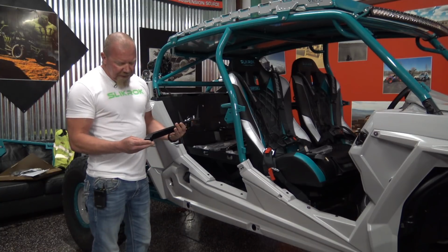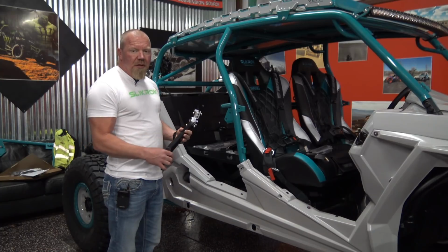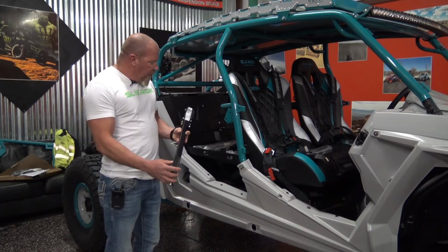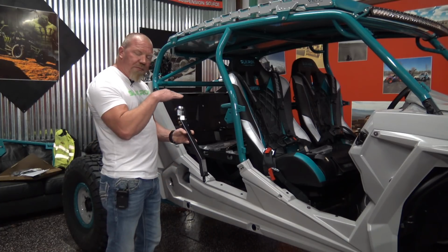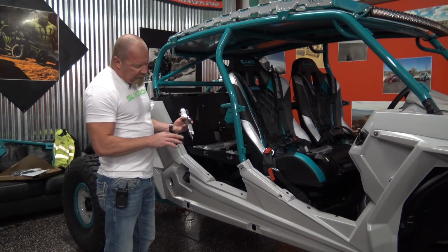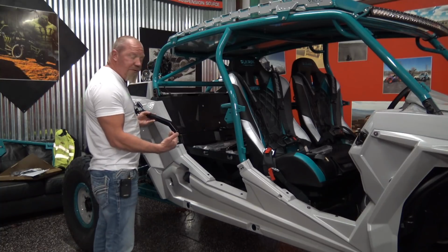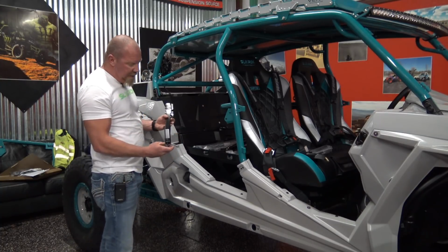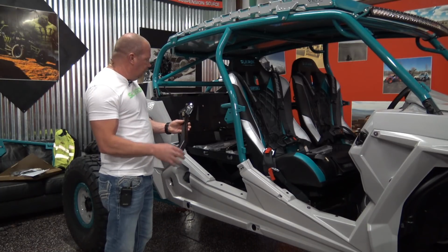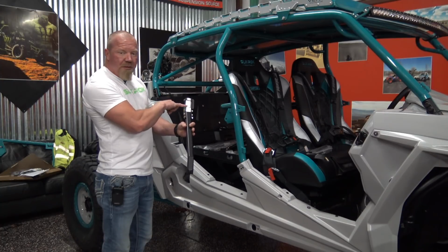But all the brackets that they come with are relatively simple to figure out. On the tail end of this video, we're going to show a lot of still pictures and show you what we're talking about here. But the aluminum bracket that's inside of them, all of them taper towards the machine so your doors shut properly. The rear brackets have a weld on the lower tab. The lower tab goes on the outside of the tab that's on the frame. So just remember that the welds go on the outside. All the bolts go through this one bracket, plus the aluminum piece inside.